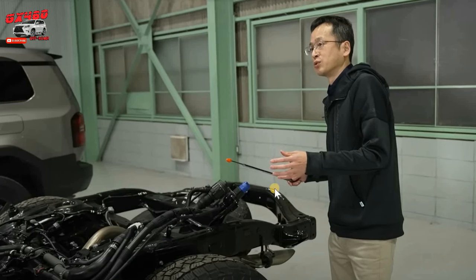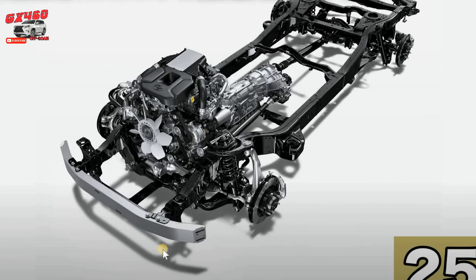The engineer explains that the rear bumper — the rearmost part of the ladder frame — has also been reduced or shortened, moved inward towards the cabin, presumably to increase or improve the departure angle. He's done some shavings on the rear to help improve those angles, and again, weight savings. Here we can see the black front piece missing from the front side of the bumper. This is the aluminum crash bar, and there's clearly a lot of breathing room for further reduction if desired.